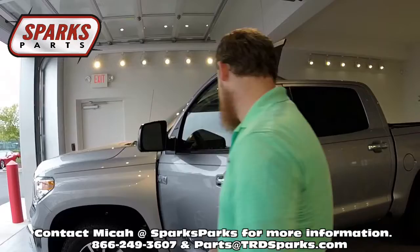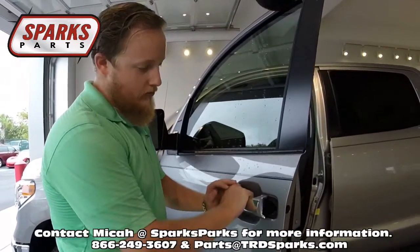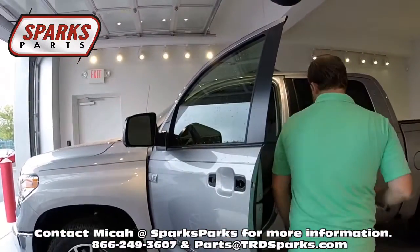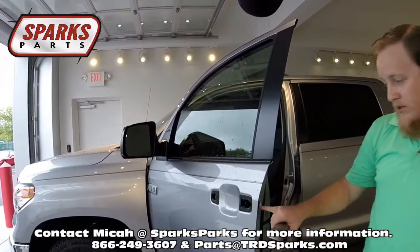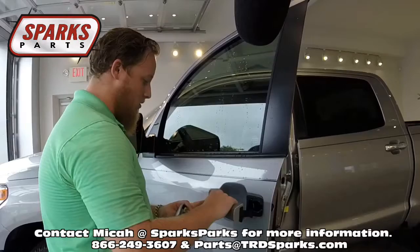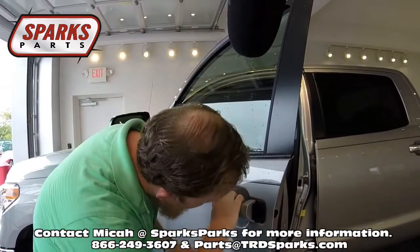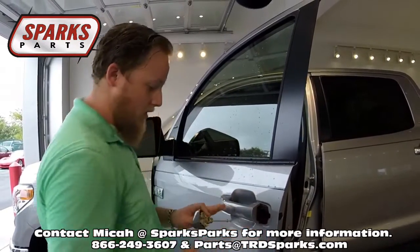It's very straightforward to change the door handle as well. It just slides out — you're going to push it towards the outside of the vehicle and it comes right out. You put the new one in the exact same way, and the screw does stay in place so you don't have to worry about it falling or anything. Take your new handle, make sure it's lined up properly, and push it in place towards the inside.